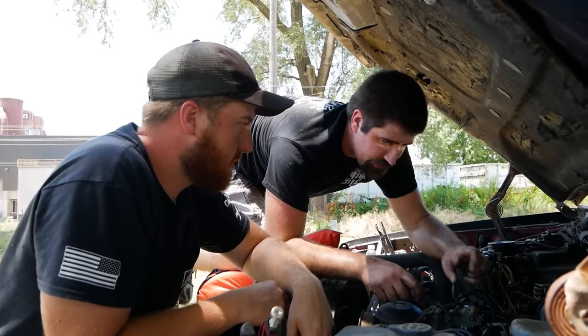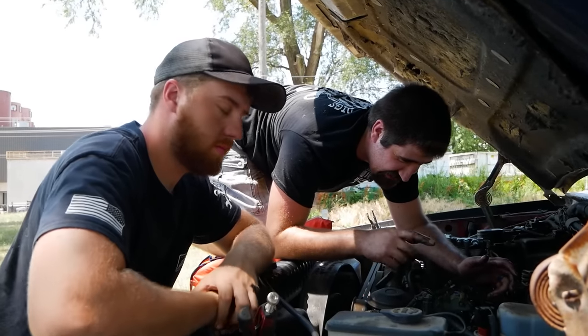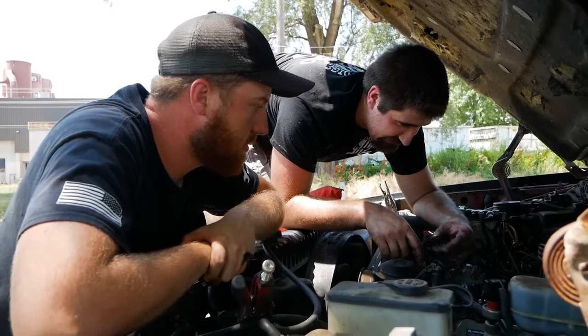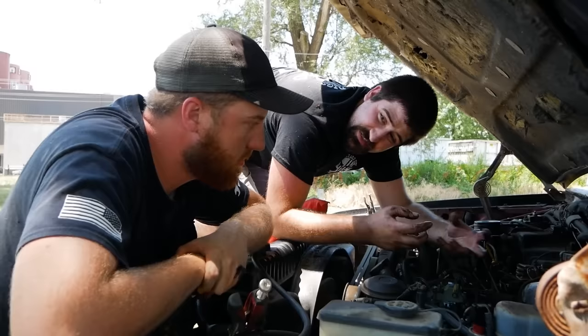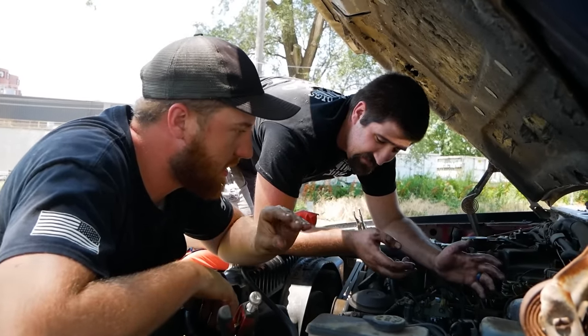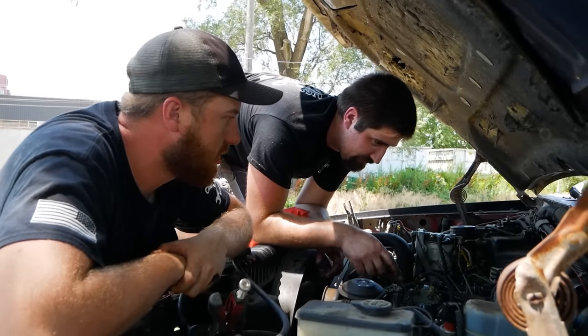the injection event, because you've got roughly, I think on these, if I'm remembering correctly, a seat pressure of 1800 to 2000 PSI. So you're getting a minimum of that shot into a cylinder that's compressing at around 300 to 350 PSI. So that clink, clink, clink you hear is just so much pressure being made. Yep, so much pressure being made in a short period of time.